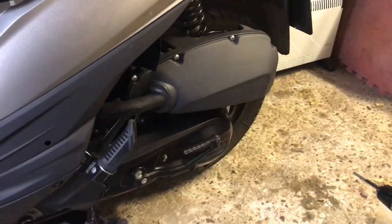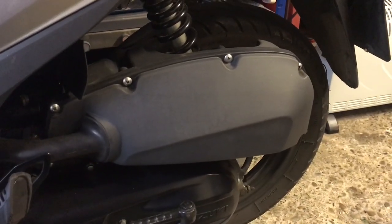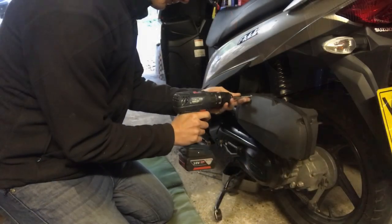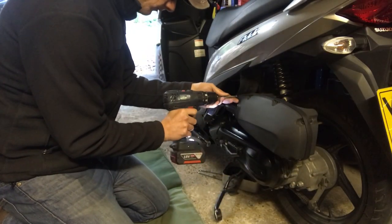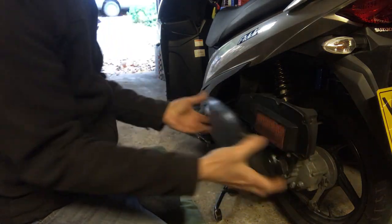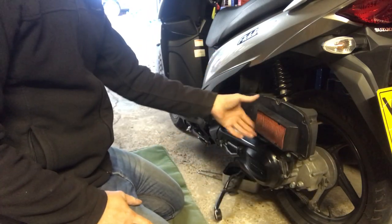While the oil is dripping, I'm going to have a look at the air filter which is in this little housing here. It has eight screws holding the cover on — seems like an excessively large number of screws to me, but hey, what do I know. So I'm taking those off now. That's all the screws released, and the cover just pulls off like that. You can give that a little clean out, or just pop it to one side. The air filter itself is here.